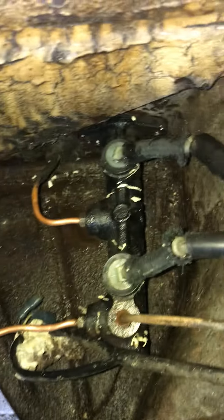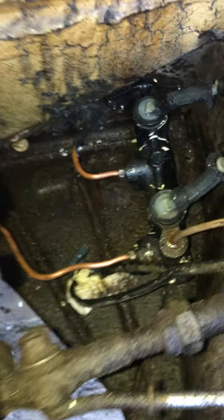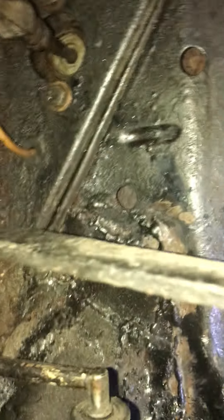I've just put this in — oh, it's leaking from somewhere. Maybe I need to tighten that a bit. There's more — I can tell there's a leak there somewhere. It's probably that one because I didn't fully tighten it. Basically I've just reinstalled this. What I did was connect the brake pipes up first, which held it in place, which enabled me to get those two bolts in.